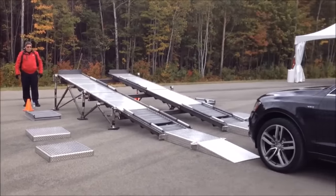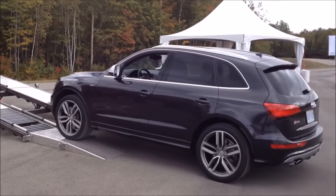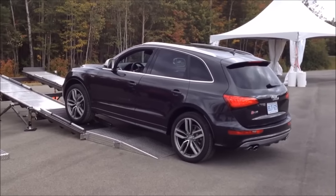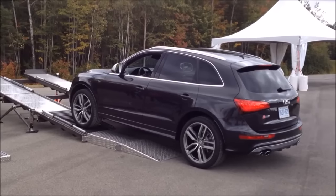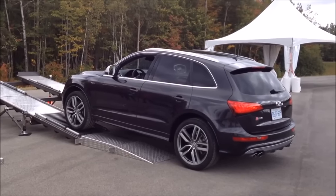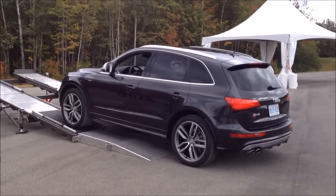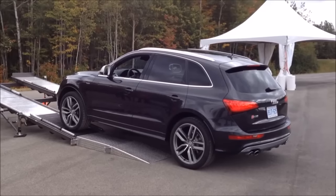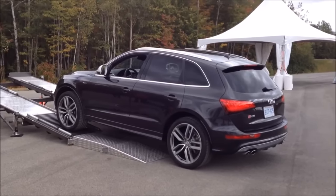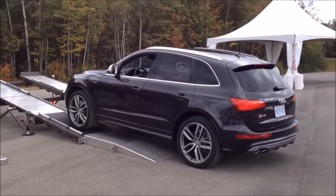Okay, Chris, go ahead. So we're going to cradle the front wheels. Okay. Back off the brakes just a tad. Okay, so now we've created a little bit more resistance. We're sitting in the divot. Chris is going to give throttle, but unlike the lady who drove in the video, Chris is going to sustain the throttle, create momentum, get the clutch pack to bind. Go ahead.